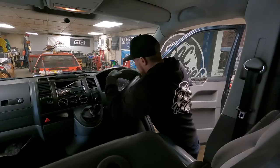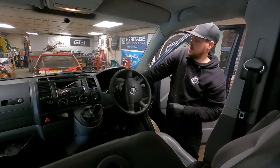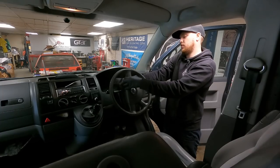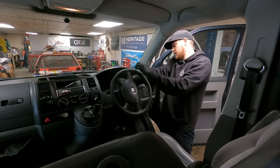Key in the ignition - just take the lock off, turn the wheel. In the back of the steering wheel you'll feel a hole; get a shortish screwdriver and you can feel there's a metal prong - the airbag pops forward. Same on the other side.